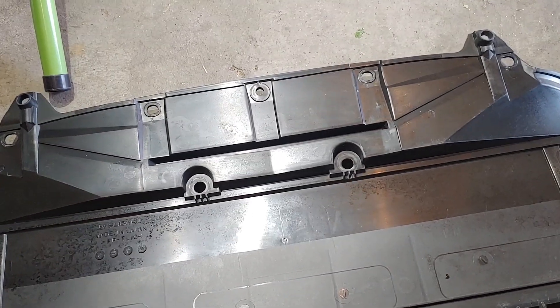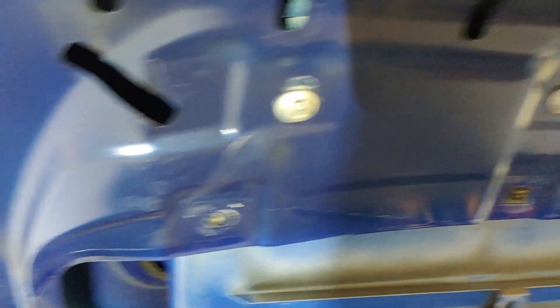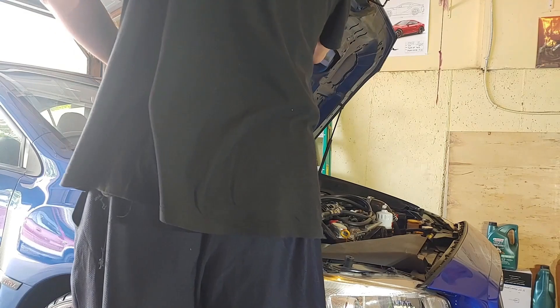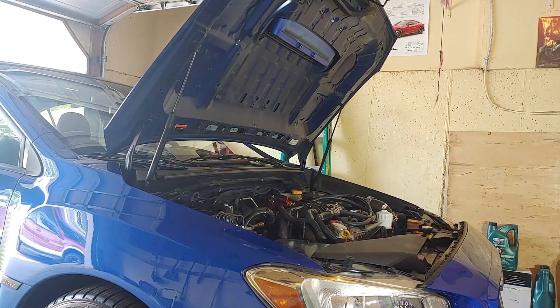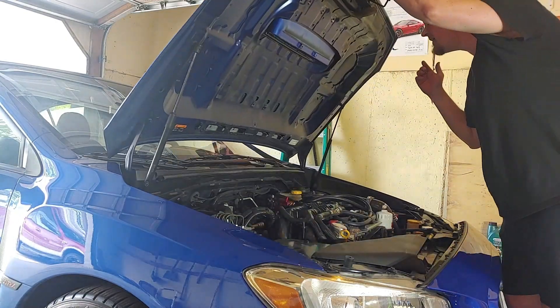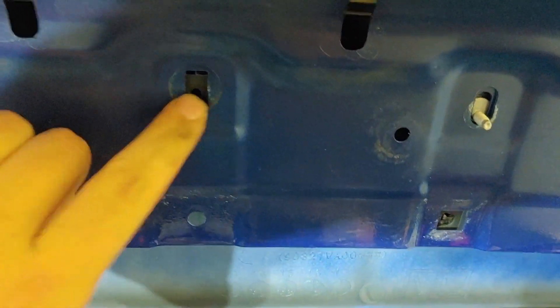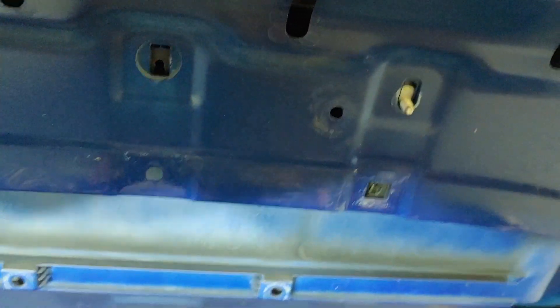Then these two as well. Under the hood, looks like there are four bolts, and there's four bolts for the new one — should line up and replace this piece here. These little guys, little baby eight millimeters. Along with those four bolts, there was a white plastic piece that I needed to pinch down to get through as well. And once you've got the four bolts and the plastic piece off, it should just come up.